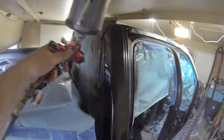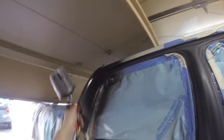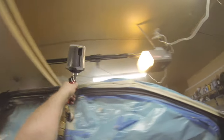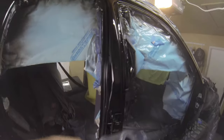I'm starting at the back of the truck. I'm really limited by the garage door because this truck barely fits in the garage — I had to flatten all four tires and take the garage door opener arm off just to barely get it in there. This is the initial coat over the primer. The paint I'm using is a two-stage urethane by PPG. It's the same paint that's used in auto manufacturing. I actually started using it when I used to paint cars back in the early '80s.